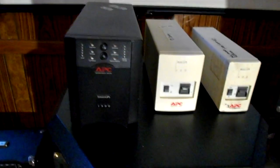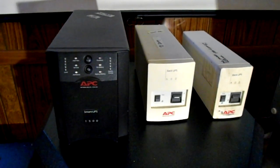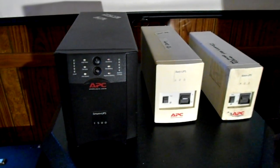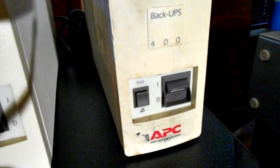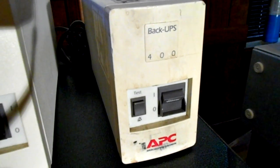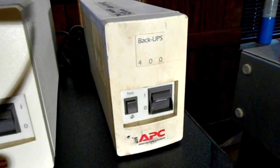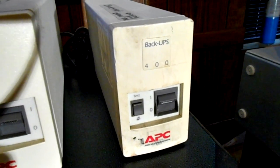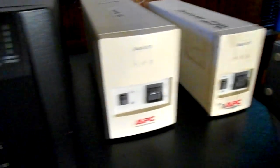I have three different APC power supplies that will kick in in the case of an emergency where the power goes out. Each one of these is rated for a different wattage, and of course the bigger they are the more watts they'll provide. Here at our shop we have quite a few of these — this one is a 250 watt, it has one 12-volt battery in there, and it doesn't last very long but it's great for spikes. It can provide power for one computer, although I don't recommend putting a monitor on it, and certainly none of these are suitable for a laser printer at all. Even though they have plugs on the back, that doesn't mean you can fill them up with just anything.